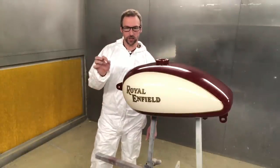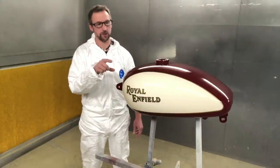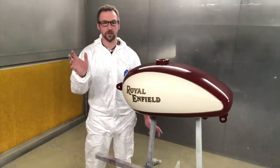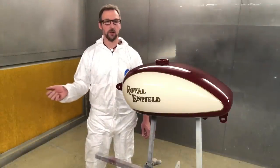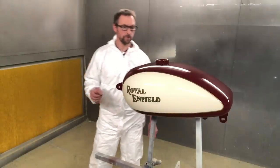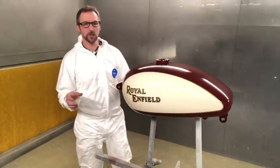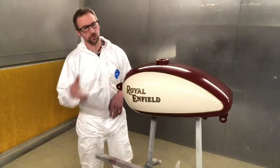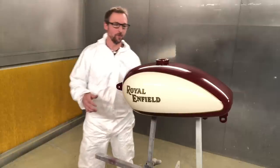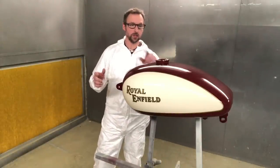That was actually a tiny little hair that had gone in while the second coat was flashing off. I saw it but I just thought it's better to leave it in there — we'll just whack another coat of lacquer on it and nib it out when it's dry. So yeah, excellent. This may well be the last video on this because again it's dragging out — I don't want you guys to have to sit for a part four. But yeah, so I might give it a polish — well, I will because there's a couple of little bits in it. So we'll give it a polish and that will be done.